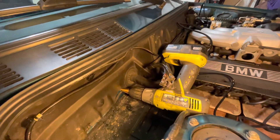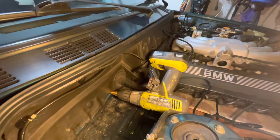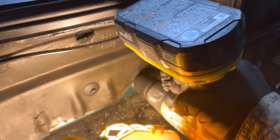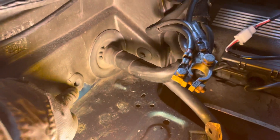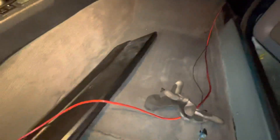Now what I'm working on is to run the wiring harness from the battery all the way to the back — this is a convertible. If this were a hard top or a four-door, the battery would be back there. I've kind of custom made my own grommet here. There's a floor plug which I drilled out the center, and I'm going to finish pulling them out on the other side so it's not being pinched or anything. Make sure that these clearances are 100%. Behind that speaker grill, take this off, and it's going to run all the way through here and out to the back.